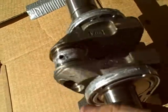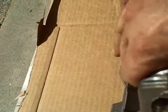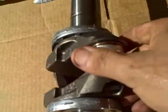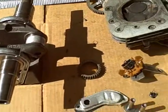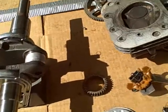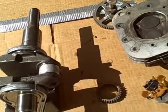And finally, the crankshaft. The crankshaft cleaned up, but we've got scoring here and I don't really even know if we can reuse this. So I think we're looking at a brand new motor. There's really no other way around it when you price out what you have to buy in parts to do this thing.